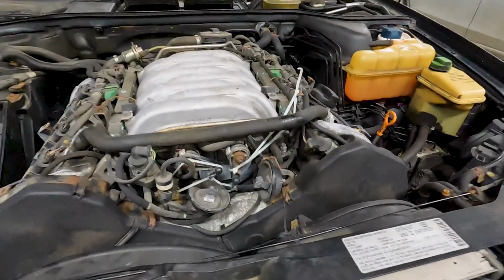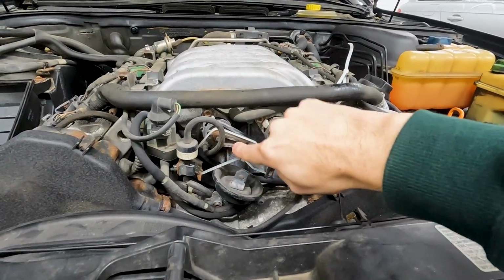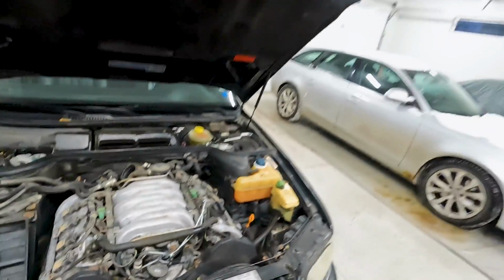Sometimes it's a bit hit or miss. And we have the intake manifold arms that are completely exploded, which is actually a pretty common problem on these older cars where they have two different actuators, but the little arms here are completely trashed. I've temporarily zip tied the manifold flaps into their idle state, but we're gonna have to deal with that. And honestly, there's just other stuff too. The transmission doesn't like to shift into its final gear very well. I'm gonna need to go entirely through this car.